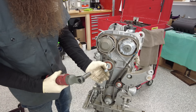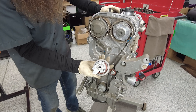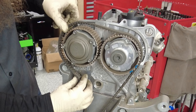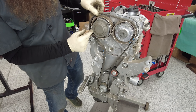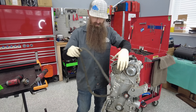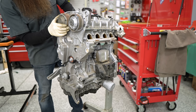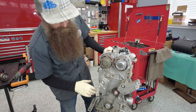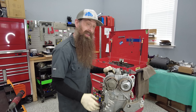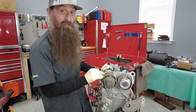This engine is timing belt driven. You can see the cam just flip. You can tell this has been sitting for quite some time because that belt kind of has its shape. Dual overhead cam, and it looks like both of our camshafts have variators on them. What's cool too is this is an aluminum engine, including an aluminum block. I actually think the 1.4 is an awesome engine for like Mark I, Mark II engine swaps.